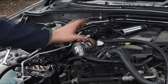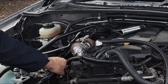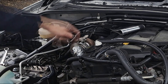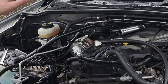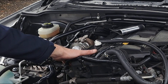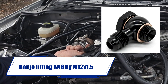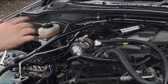As it stands I've had to clock the turbo quite a bit that way to get the drain, otherwise I wouldn't even be able to get to the drain fitting. So the way I was going to do the whole drain has changed. I had issues not only with the drain but also with the distance on this side - I couldn't get one of these fittings on this side, it's just too tight. So I've ordered a completely new type of drain setup: an M12 by 1.5 banjo fitting. Basically it will have a bolt going in there and the banjo has an AN6 fitting on the end, and it will poke up and go that way. That's a work in progress.